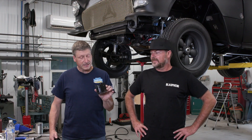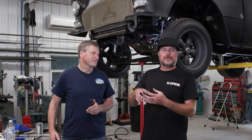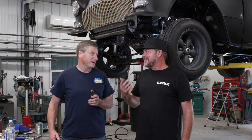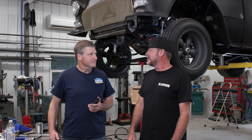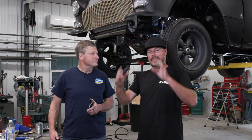They're extremely close to the finish line with the brackets made. However, what wasn't visible was that when they removed the trans, half the bolts were missing, causing the trans to be cockeyed in the car and chewing up the throwout bearing. They also found a water leak in the back of the engine block. What started as an easy four or five hour project turned into about 15 hours. They also confirmed the Millermatic 142 handled everything needed for the race car, so it's going to find a new home in the race trailer.